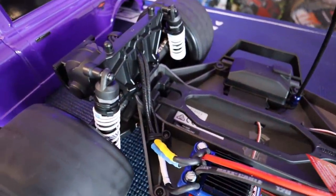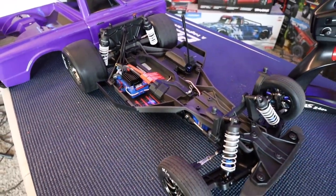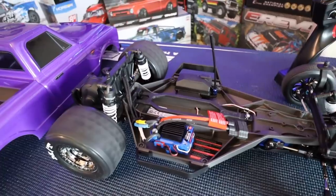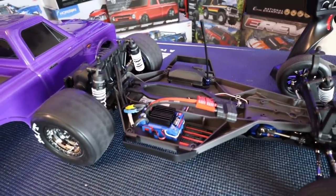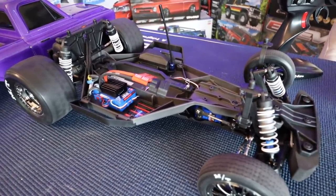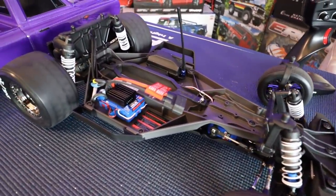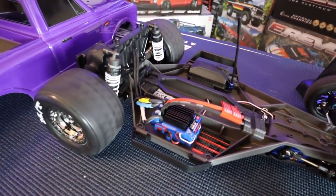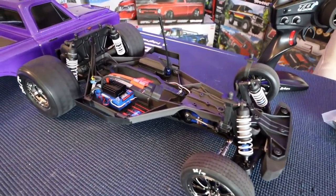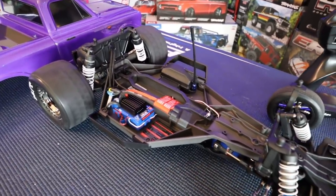Another thing about this car is they updated the TSM, the stability management. You guys know from my previous videos how much that makes the driving experience cool. Because drag racing is all about how much you can keep it in a straight line, what they did with the TSM is they have TSM off on acceleration. That way the skill of making sure you got the throttle right is there. When you decelerate, it's back on, so your car doesn't lose control on deceleration. I think that's gonna make it really cool from a racing aspect, only because I was thinking before they released all this and we knew about this, if everyone has TSM, everyone's gonna go right down the middle.